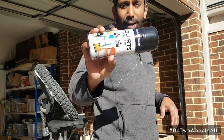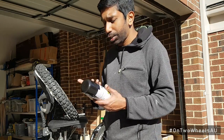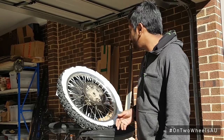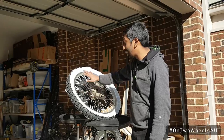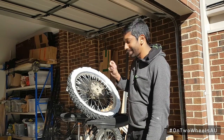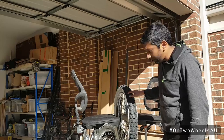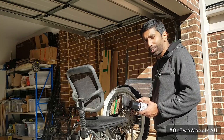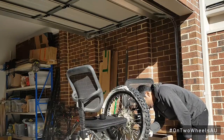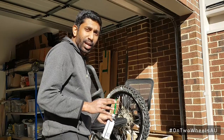I'm going to use the Squirts primer-and-paint two-in-one in gloss black. If you're in a colder climate, keep the can dipped in hot water to bring it to a decent temperature, and make sure to shake the can well. Here's a trick: instead of painting the wheel flat on the ground — which causes dripping and missed areas — take the axle, put it through the hub, and rest the wheel on something that lets it rotate freely. That way you get an even spread all around. I can see a few areas I've missed but I'll let this dry and cover those in the second coat.